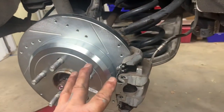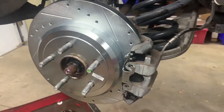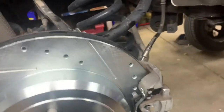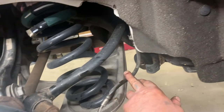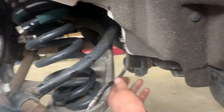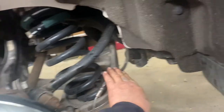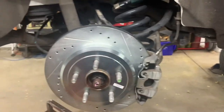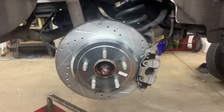The spring clip is in - make sure those hooks are seated. Hit them with the blunt head of a screwdriver to make sure everything's in good. Everything's torqued. One other thing to check: make sure you've got the caliper on correctly so the brake line isn't twisted. Make sure it looks nice and clean.